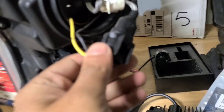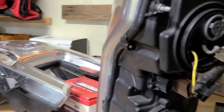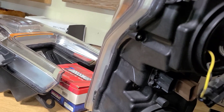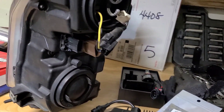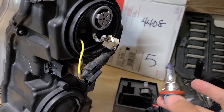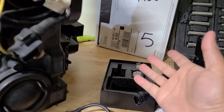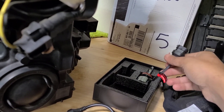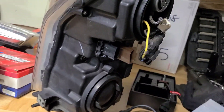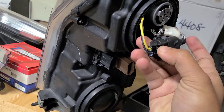I do have the first one in — it's a little difficult. They have a little bit of a tail, so you kind of have to sneak your hand in there and plug it in with one hand. Since these are LEDs — it's essentially a light emitting diode — a diode is essentially a check valve for electricity, whereas a regular light bulb is just a thin wire that emits light as electricity passes through it. With LEDs, since they're a check valve, you can only plug them in one way. It even has a little warning sticker that says if there's no power, you've got to flip it. I did test it out and noticed mine weren't turning on, so I had to reach back in there, undo the clip, pop it out, and flip it over.